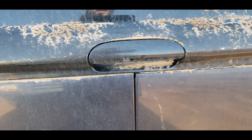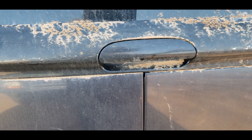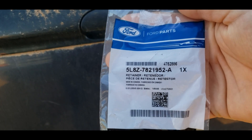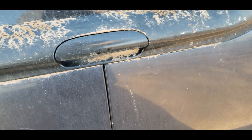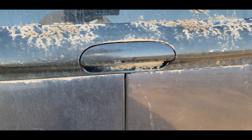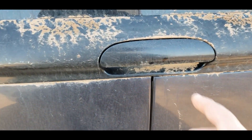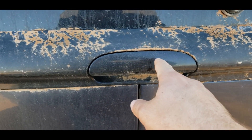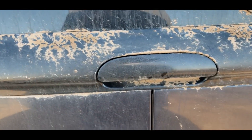When it finally gave up the ghost, I popped the trim off the inside and got to look at it, and what it looked like broke was this right here — this little retainer. The part number and link to where I purchased it will be in the description below. It's kind of a pricey little piece of plastic; I think it was like $6.35. All that happened was there's a rod behind this, a latch rod, and that little plastic piece threads onto it, then snaps into the latch itself. So when you pull on it, it activates the latch and opens the door.